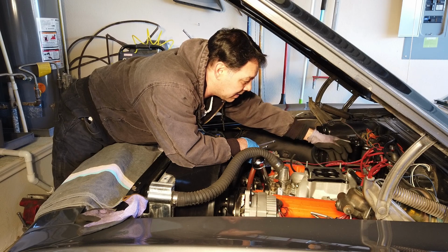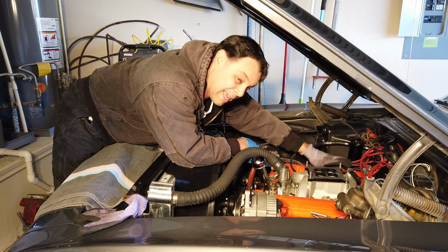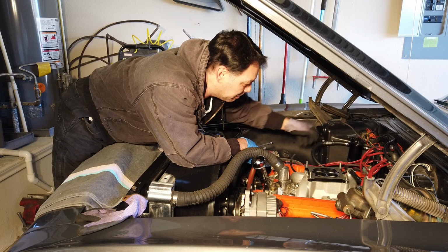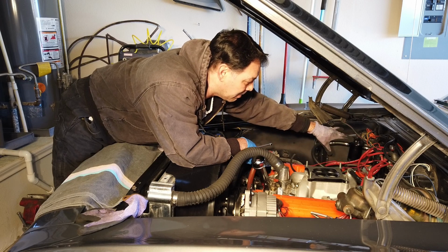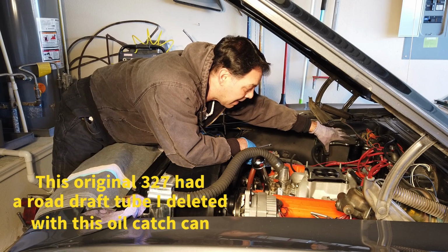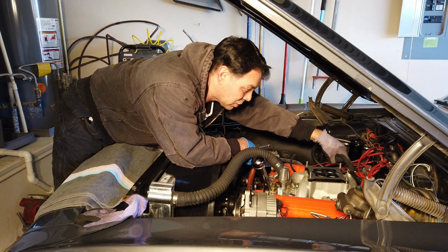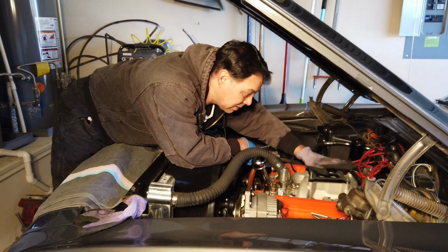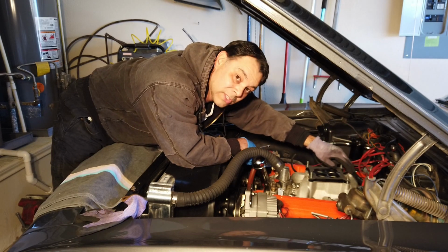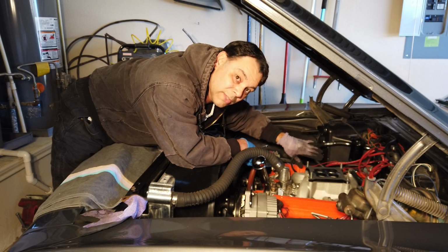It's connected to a vacuum line that goes down to my transmission. I have a 2-speed Powerglide, by the way, and that is original. And the other one is this big giant line that comes out of my exhausted oil canister. So I'm not really sure if it's the actual T that's causing the issue, or if the hose is so dang thick that it's making the Killshot not lay flat. So now I'm going to have to see if I remove this hose, if the Killshot will actually lay flat, and if so, we'll see what I can do. I could just redivert this somewhere else.